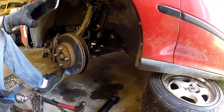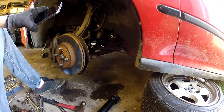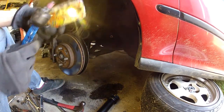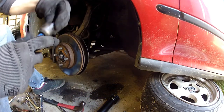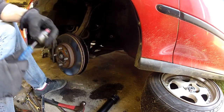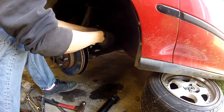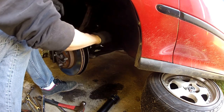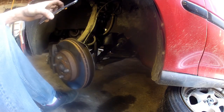Unfortunately I didn't buy new boots — I didn't know those were that bad. But here's our new inner tie rod. The loctite comes already on there, which is convenient. Screwed right back on — the book calls for 40 foot pounds on the inner tie rod.